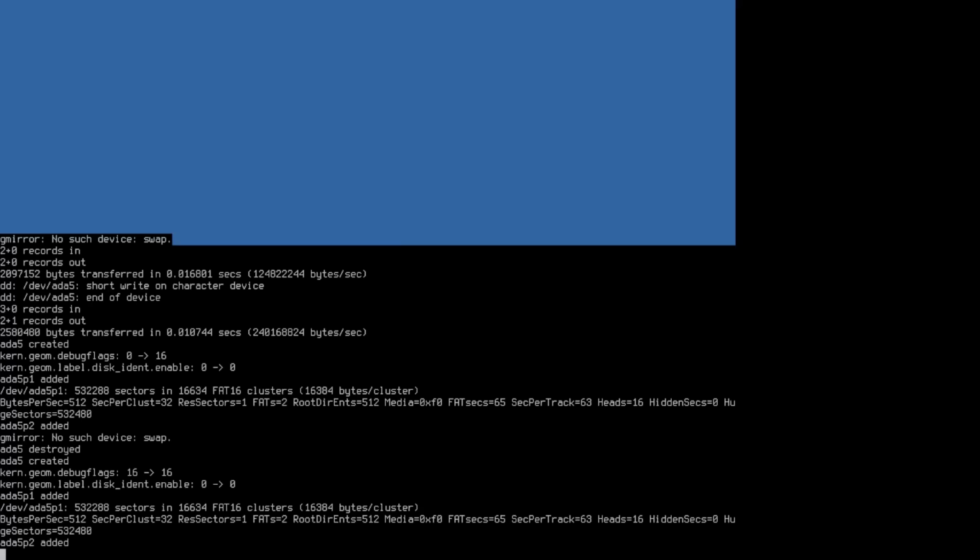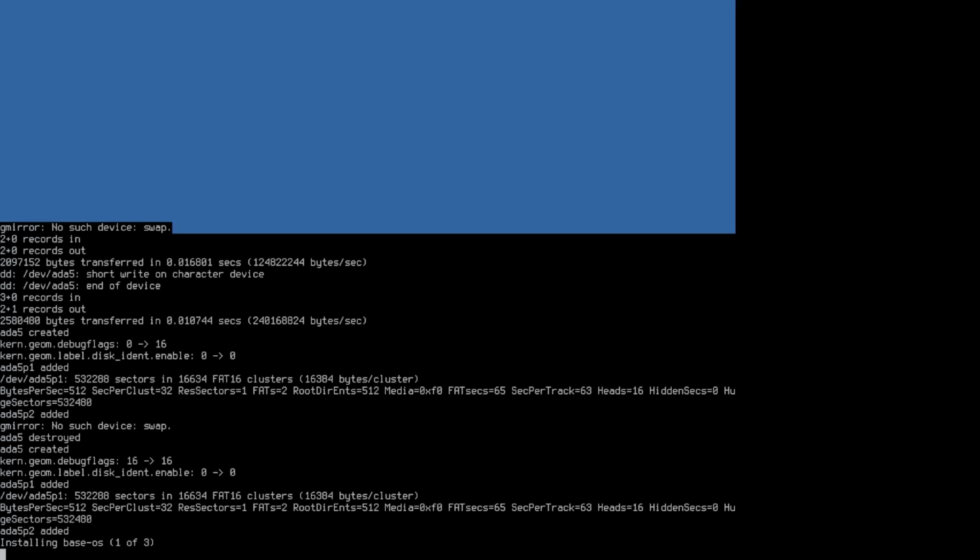One thing I should note is that I did swap the video card. That video card kept showing up green on one capture card but worked fine with the other. Every time I tried to boot TrueNAS, I couldn't see the install prompt. It just wouldn't let me install anything, so I had to swap that card. Right now I have a GTX 750 in there, but I'm going to take that back out because I want to build a retro gaming machine with that card, but I will put in an NVIDIA Quadro that I have that I'm not using for anything. It's just that the Quadro card only has DisplayPort and DVI, and I don't have anything that'll connect to that right now. I could order an adapter or something like that, but for now, we'll just let it sit.